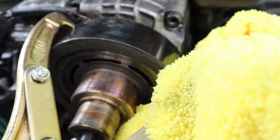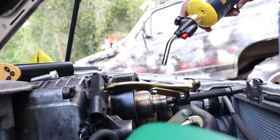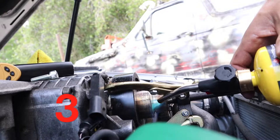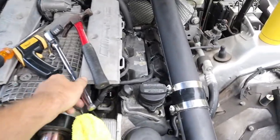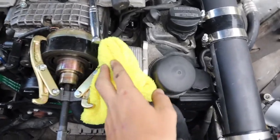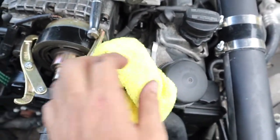With this rig, it's going to slowly start pulling out and you'll start hearing a pop. I've been trying to get it on film but it's just too hard to frame up. When you start heating it up, remove the towel, heat it up and you'll hear a pop. Let it cool down and start over again. Did you hear the pop? You just keep doing that and it's inching out slowly. I think this is one of the safer ways to do it — if you just crank the puller without heat, you're probably going to start damaging a lot of stuff. I'm using a 6-inch puller with a 14mm on it, not using a breaker bar. Do a lot of padding right here and use that as your brace — I kind of damaged that part, which was 100% my fault.